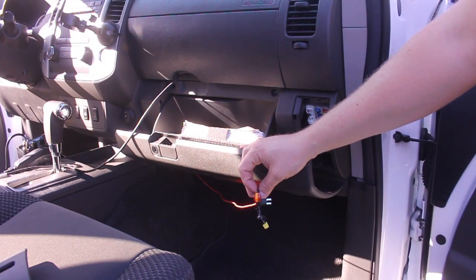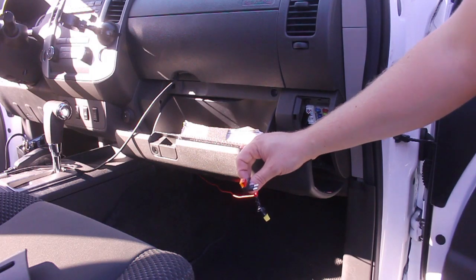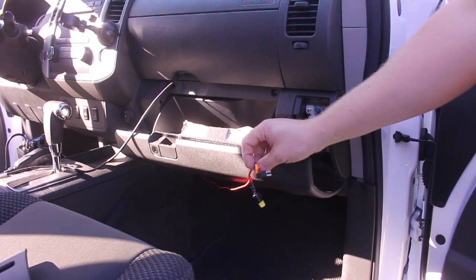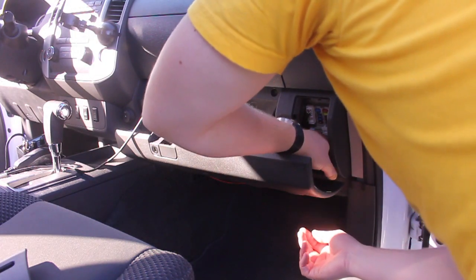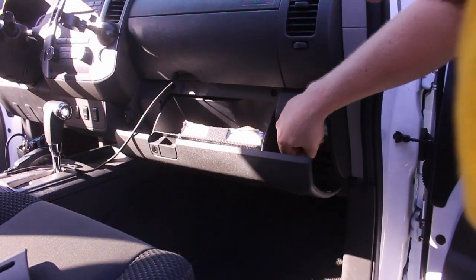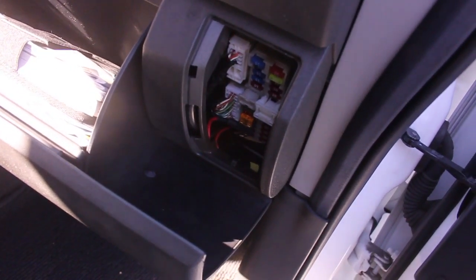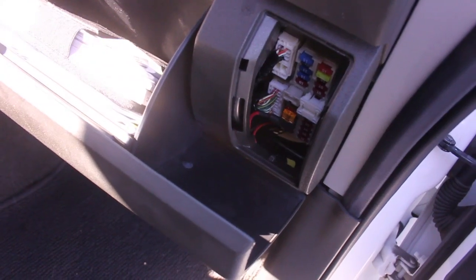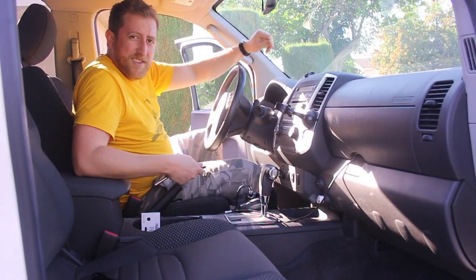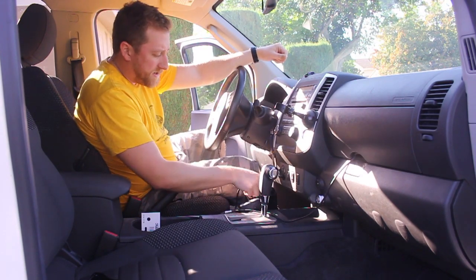The radio still has its own fuse. You're not jamming the cable into the actual lead, which is what a lot of radios actually recommend — the instructions for this radio tell you to just tap into the fuse. That sounded janky and didn't feel right. I know a lot of guys go to the battery, but I don't like that idea either. All you do is feed this back in and plug it back in. Here it is attached, plugged directly into the fuse box, with two auxiliary fuses off to the side. If you ever have to change this on the road, you just unclip it, replace the fuses, plug it back in. The radio will only receive power when the car is on, so you don't have to worry about draining your battery.